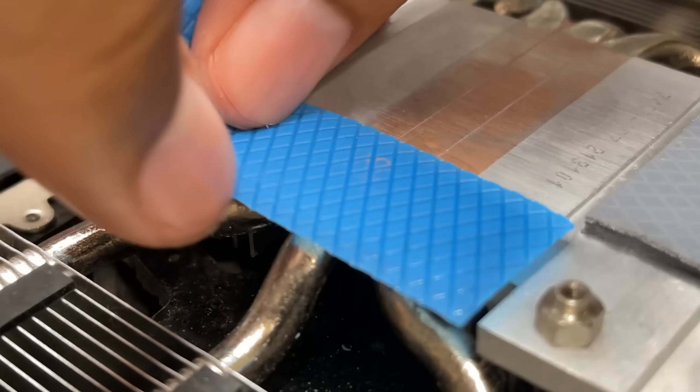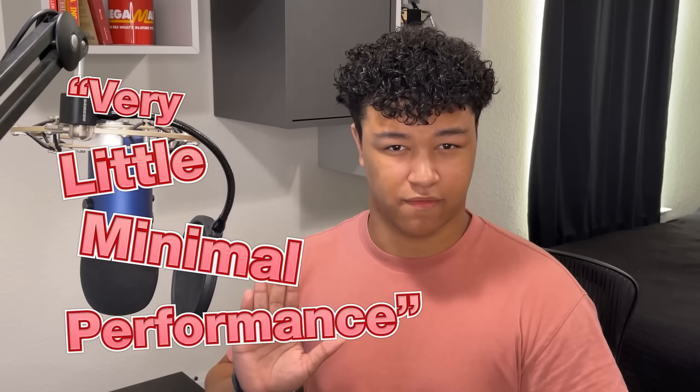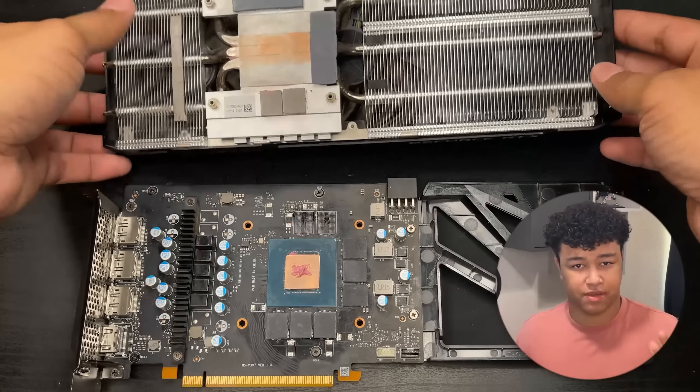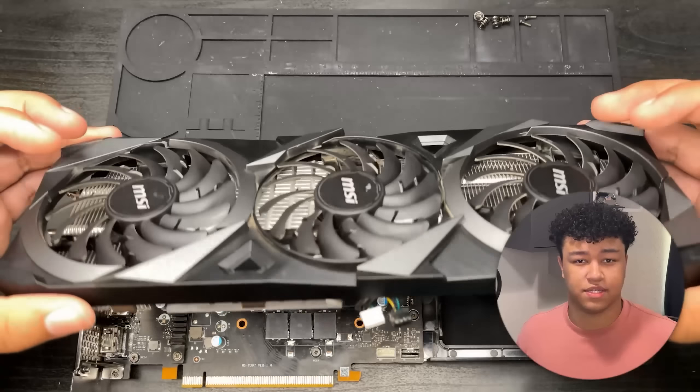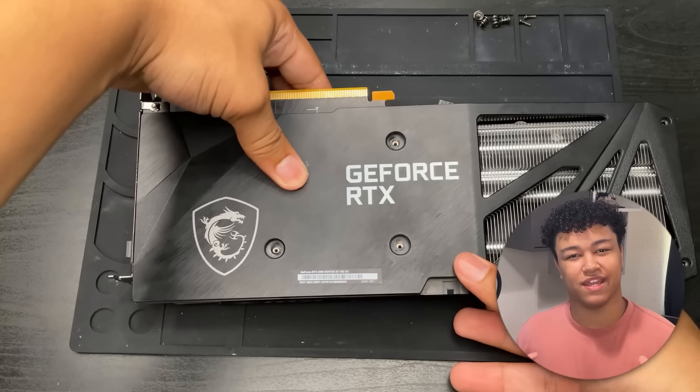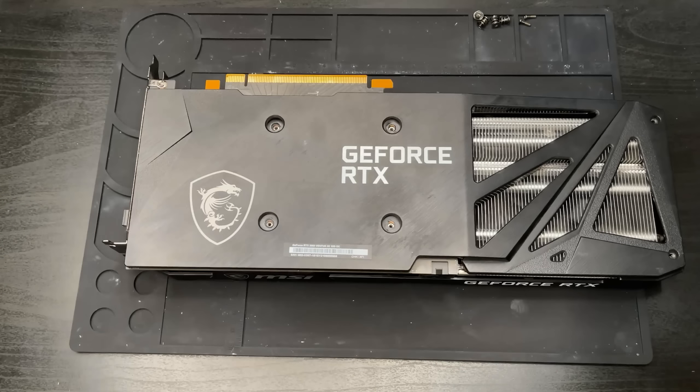To make up for my sins, here's a little bit of thermal pad ASMR. Now keep in mind that the memory type on the RTX 3060 is only GDDR6, which means the memory itself is not getting that hot. In fact, there aren't even memory temperature sensors on those dies, so we're losing very little performance by basically stacking two sets of pads on top of each other. And now we're just about done — all that's left is to slap these two pieces of the GPU together to complete our GPU sandwich, use my magical screw tightening technique, and just like that, we're finished.